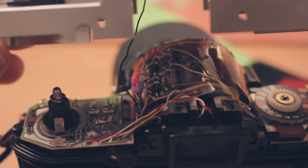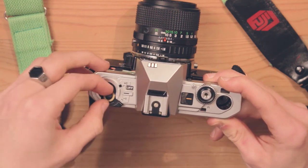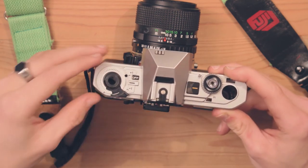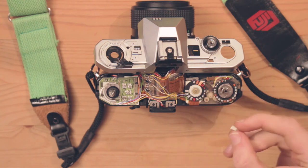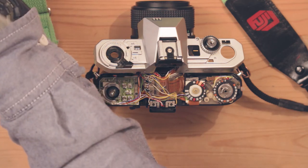Don't lift it all the way up because there's a black wire underneath that's connected here for activating the flash and other accessories. Remove this ring carefully — it'll fall and you'll lose it, so don't. Now you're inside. Watch out for the VR button — you'll drop it, you'll lose it, so don't.